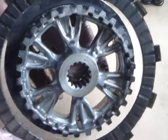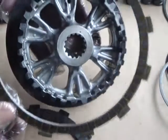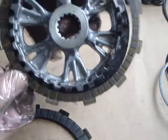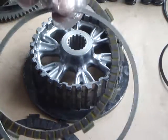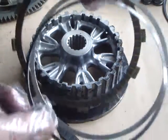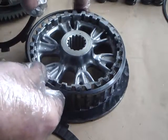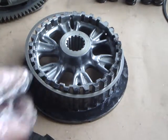I think this is not the right plate for that position. I think it should be a plate like this with a much larger centre, the reason being that it goes against there, and within this plate goes a metal ring and then a spring. This is actually a spring — a conical spring, large diameter — and it sits on there. These two both sit on the hub.